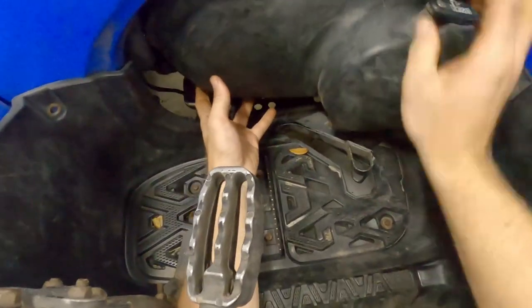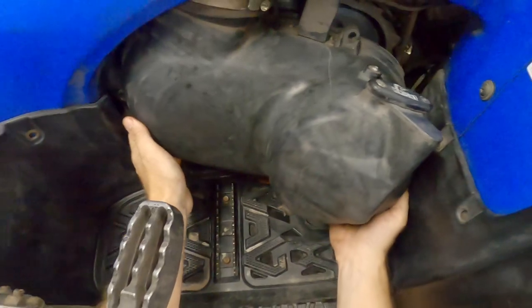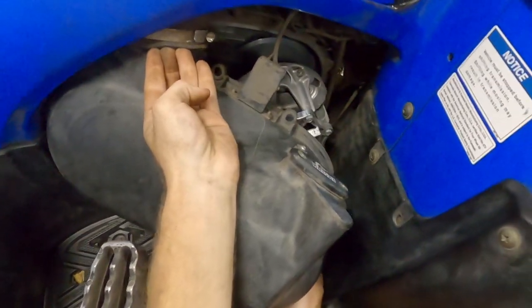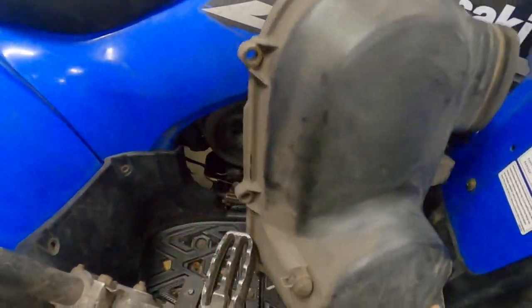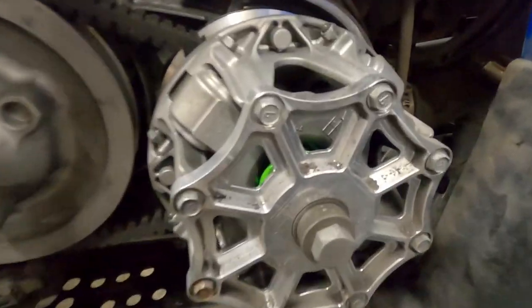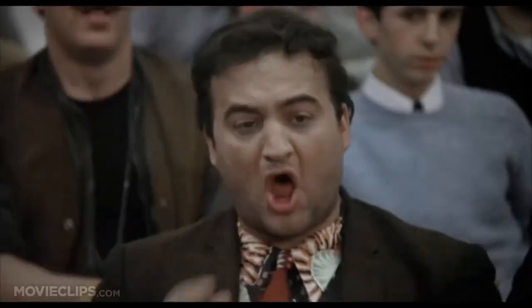All right, we're going to take off this box now and see what condition the clutch is in. Keep in mind I have not even opened this belt box in over a year, so there might be a bunch of dust in it. Just got the belt box off — I'm already seeing some belt dust. Not too bad. We're going to blow it all out and get all the dust out of there. You should do that every so often anyway — even your stock clutches need to be blown out, because dust gets in and wears down your clutch sheaves a lot faster.